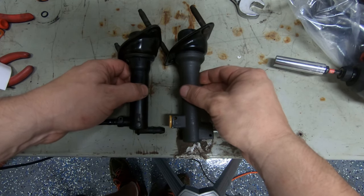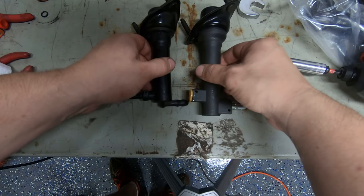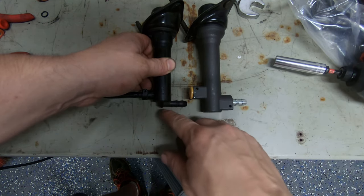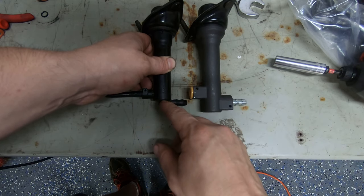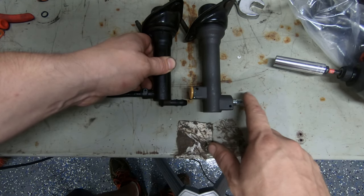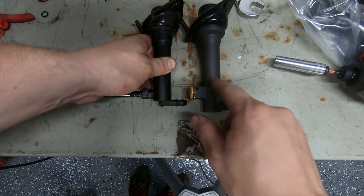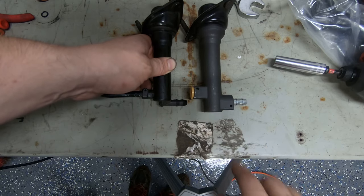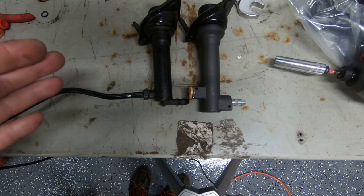It does not, however. Try to line these up for you best I can. The metal one is longer — the body is probably a good half inch longer. The clutch fluid reservoir barb fitting comes out of the side of the casting, whereas the barb on this one kind of comes off of the end. And this part of the master on the very end of the body made hard contact with the Hooker headers. So I've got to get another master.